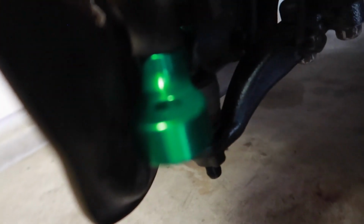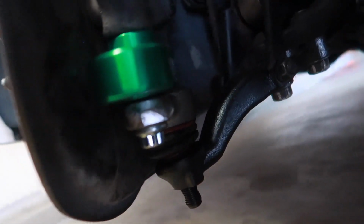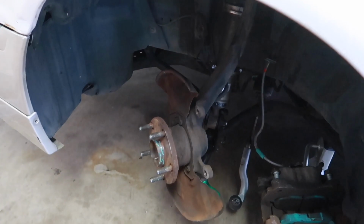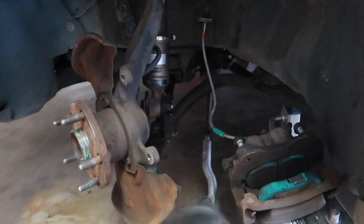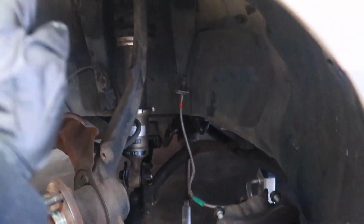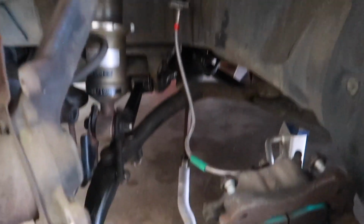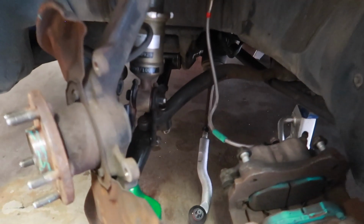Got the drift knuckle installed. Looks great, just have to put the castle nut on the lower ball joint. But looks good. I'm really happy with how everything fits up, and like I just mentioned, you can already tell how much more angle we are getting. So before I bolt in the outer tie rod, I want to knock out the driver's side and then center the steering rack so we have equal adjustment left and right.